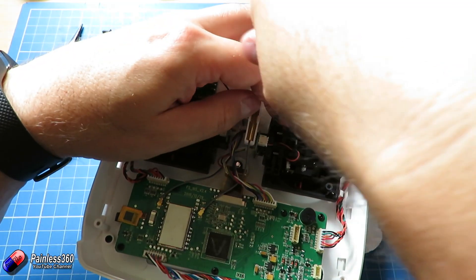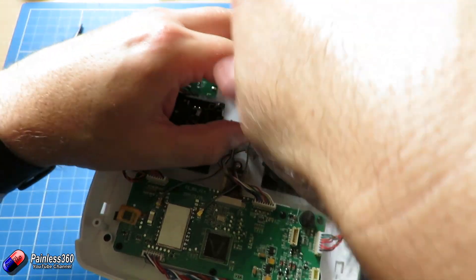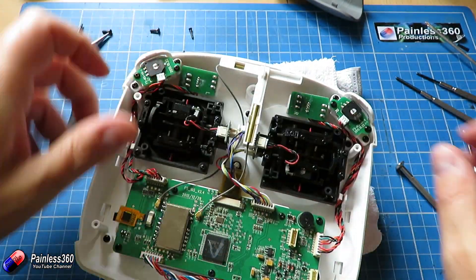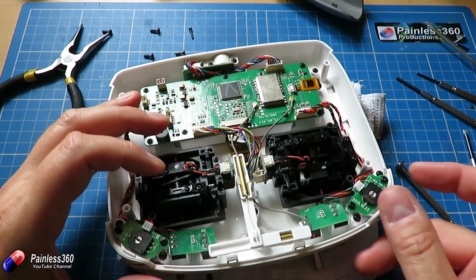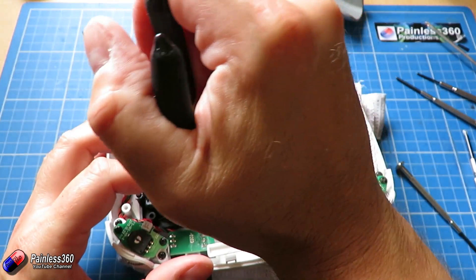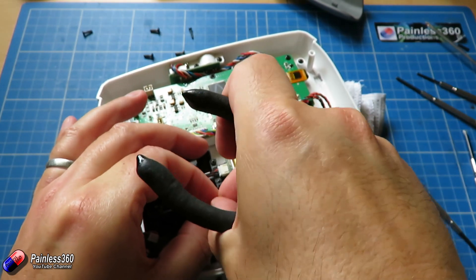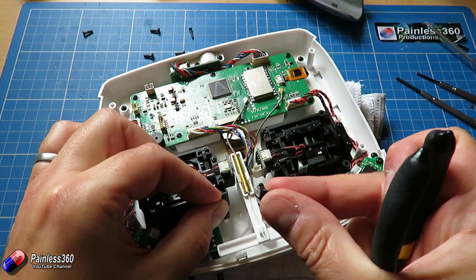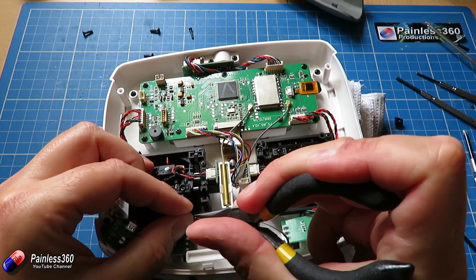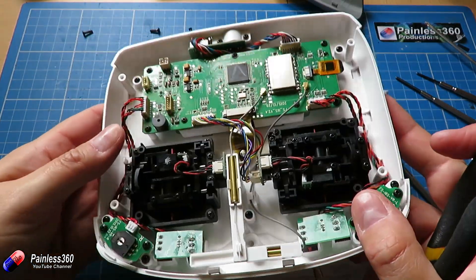You have to be very gentle — this is a really, really long screw so you're going to have to keep at it, much longer than the ones at the back. Then very, very carefully — this is where some snipe-nose pliers come in handy — just pull that top piece off. While you hold it you can slide it off the top of the spring, and then the spring itself will come out too. So there we go, the spring has gone.